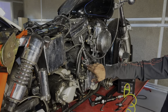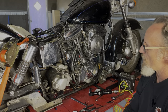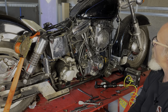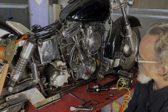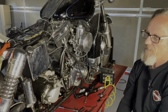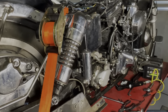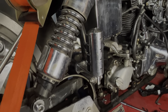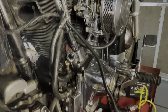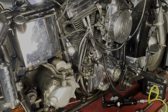The top end of this motor, from here up, is an Evo — which is the next generation motor. Evo is the Evolution Harley motor that came back in the mid-eighties when AMF was bought out by Willie Davidson. AMF had Harley Davidson from 1970 through around '79. In '79 or '80 there was a transition period — I think '82 was the first year of actual true Harley Davidsons after AMF. The Evo didn't come out till around '89 — I'm a shovelhead guy, so you guys can comment and correct me on that. This motor has been stroked, and I'm believing it's a 96 inch. Stock, this would have been an 80 cubic inch, which would have been 1340cc, so if it's stroked it could be up around 1600cc.